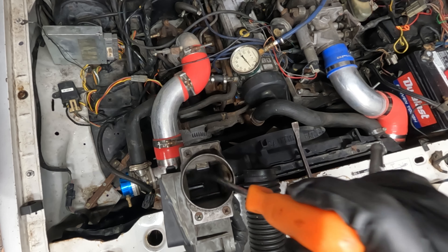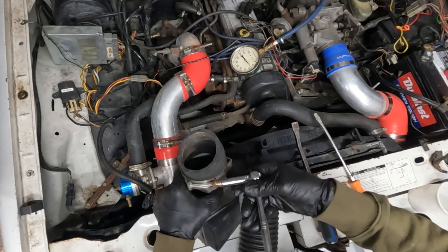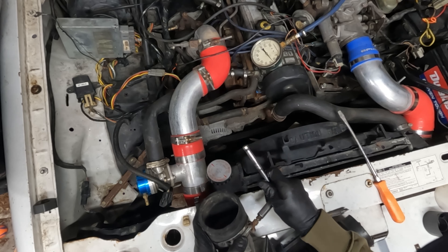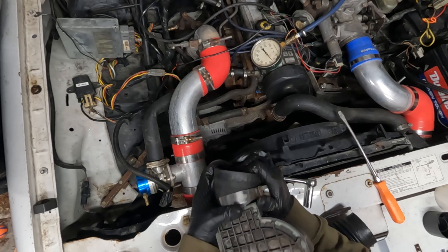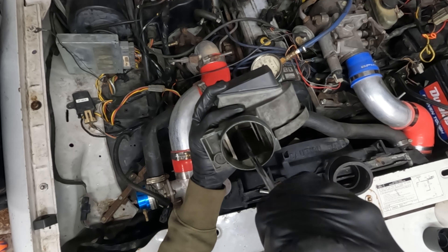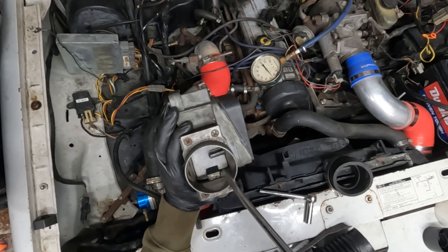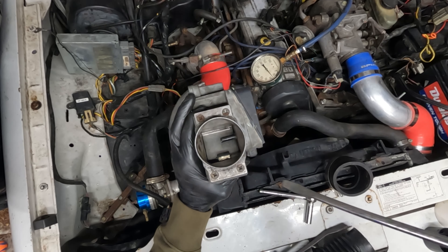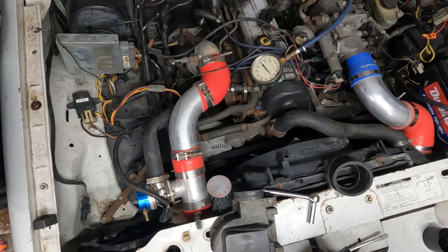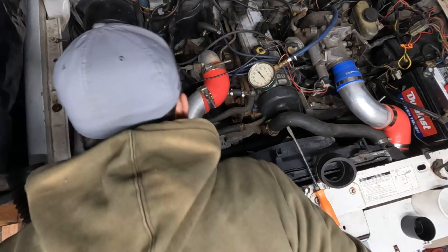It's getting a little smoky in here. When I unplugged what I think is the mass air flow sensor, it seemed to start and tried to run a little better. I did put a different PCV in it and the pressure has not changed. I think they put this thing on backwards because air should be able to push through here. Yeah, I think they put this on backwards — it was supposed to be reversed. Oh my god, I think I might have figured it out.